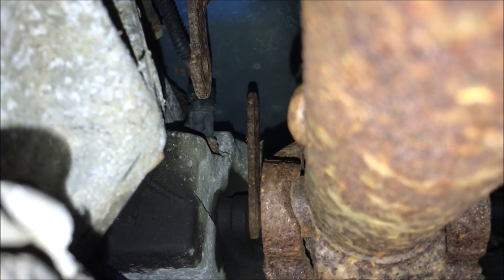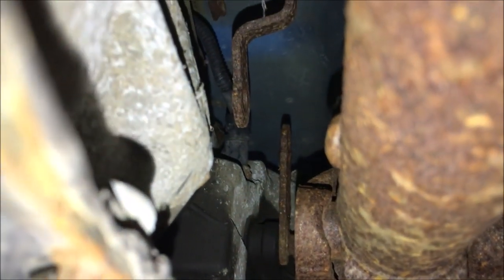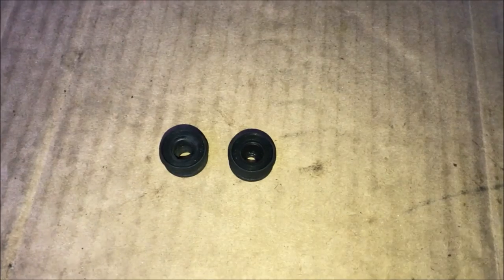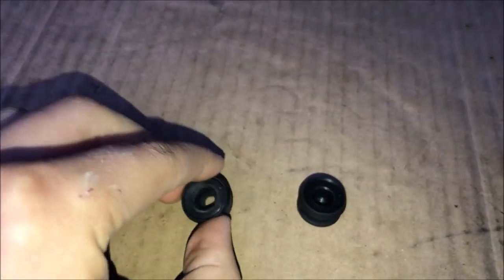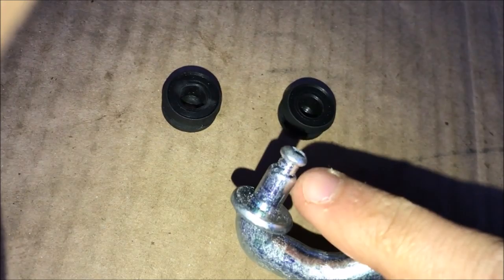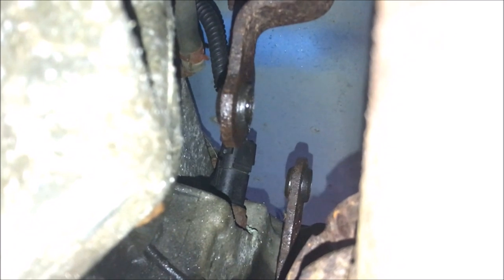It's going to be really hard trying to hold my phone and get that linkage in there, so I'll show you guys the update in a second. As a little pointer: these rubber grommets have a big end and a small end. The small ends go towards the transfer case — towards the passenger side of the truck — which is where the end of the linkage pushes into the big side, because the little side is what holds the little groove in place.